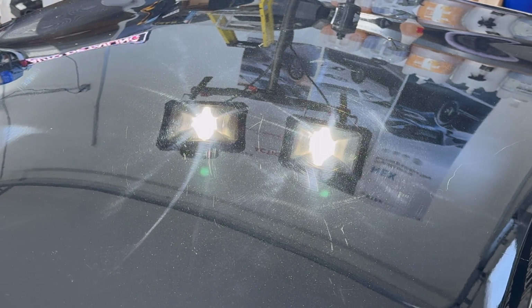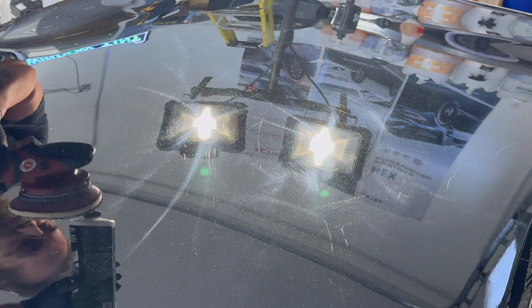I know I said the rotary felt a little underpowered for how fast your speed setting was, but I found that to be true with most cordless polishers anyway. It's the slight drawback of cutting the cord. I think you have to run polishers slightly faster than what you normally would a corded polisher.